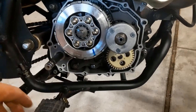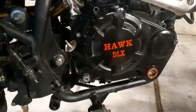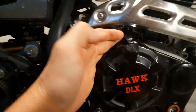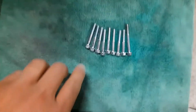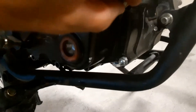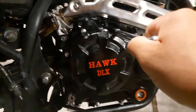I've got everything installed and back in place. I'm going to go ahead and put the cover back on, fill it up with oil, start it up and see if it fixed the problem. Two things you're going to want to be advised of when installing this cover: one is this clutch lever right here — you're going to want to hold it in while you slide it on so that it lines up. The second thing is all the bolts are pretty much the same size except for one. This one really long bolt will be installed on the side right here. Make sure each 8mm bolt that holds this cover on is tight.